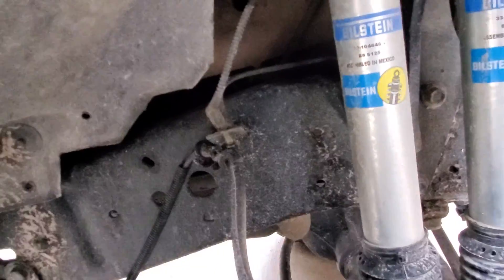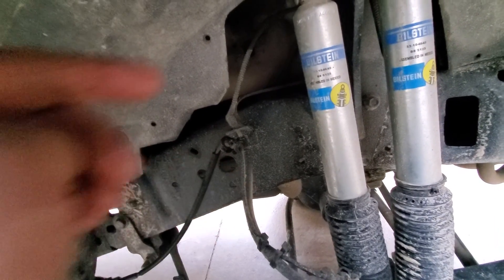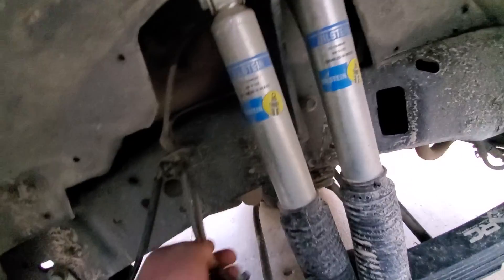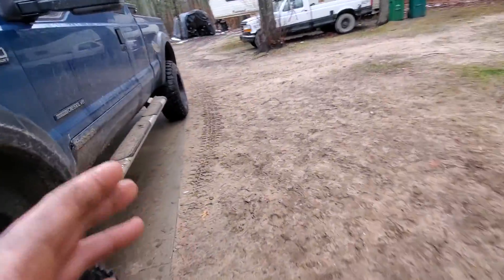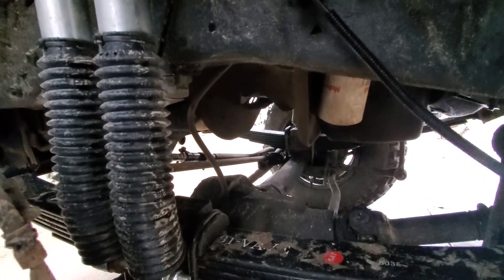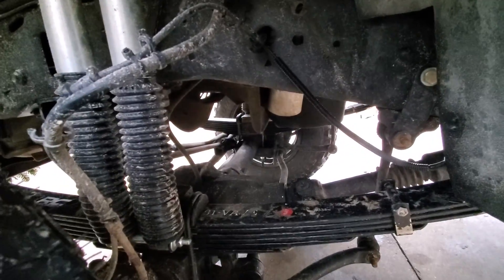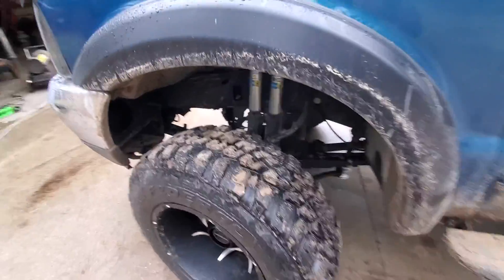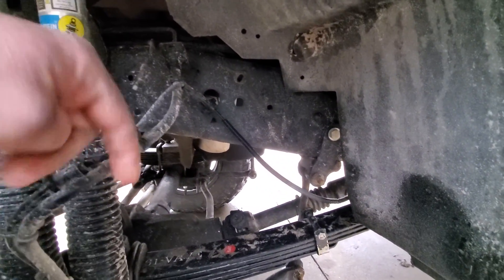When you look at the bracket for the brake lines — if you don't address that, your rubber brake hose will actually be really tight. I bent that bracket down into a 90-degree angle on both sides so that it gave my brake line and ABS wire some more distance. The rear brake line has enough travel since they make a pretty long hose. I also recommend extending your front axle vent because the factory one is really short — before I changed that it was very tight.